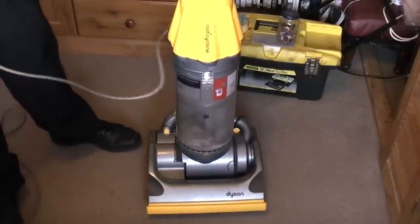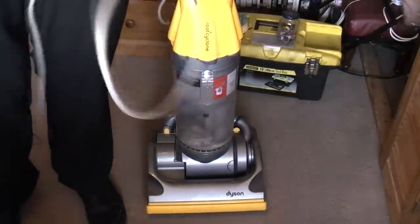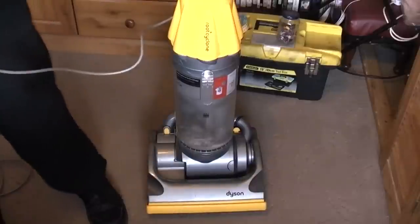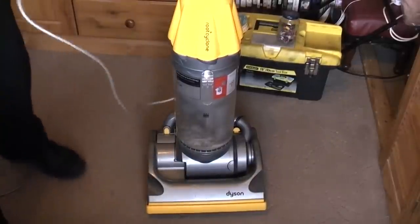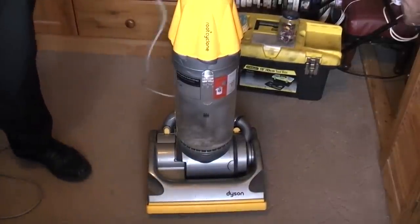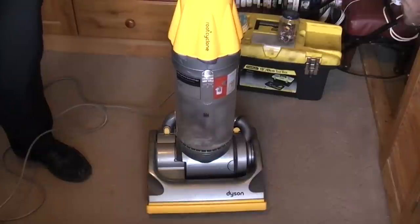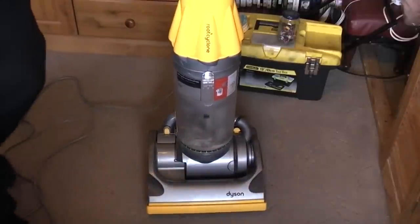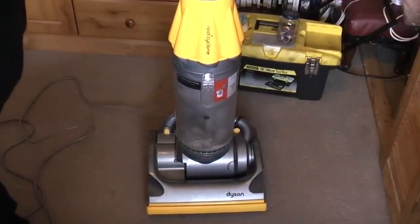Well, that works astonishingly well! So if you ever accidentally run over your cable with a vacuum cleaner — or with a DC07 in this case — change the cable and give it a go. You can buy old cables very cheaply, you can buy new cables very cheaply — you might just need two crimps. I hope that helps. Thank you very much for watching, and I shall see you soon. Bye bye.